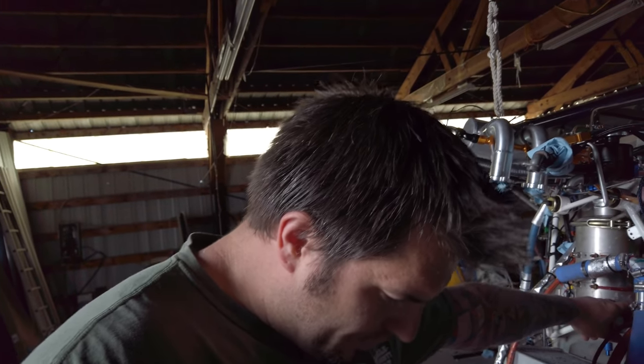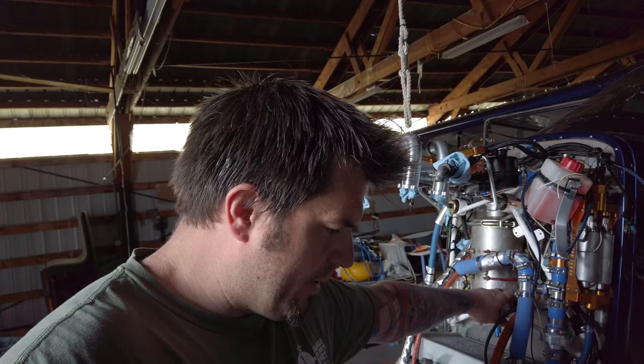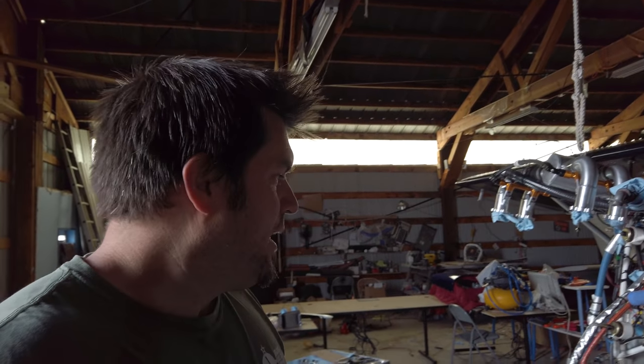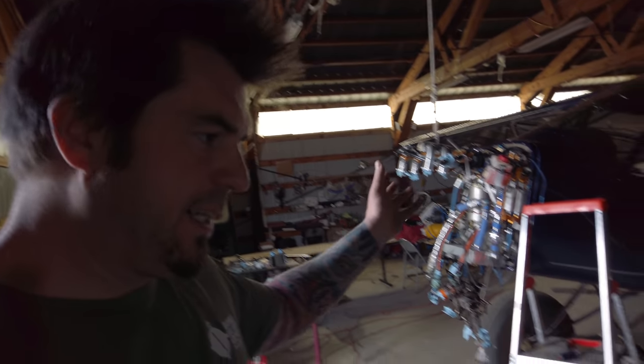So anyway, the turbo in a sense won't have to work quite as hard, but it's still going to make plenty of heat. It's still going to need an intercooler. So I might be able to make more power without an intercooler, theoretically. And hopefully this small intercooler deal that we're working on will be enough. I'm shooting for going to 915 power, getting up around that 140 horse or a little more, since they tend to make a little more than that, at this altitude. Now that's a conservative number, because this engine will be built to take 155, maybe more. But I'd like to stay conservative. I was trying to do that before. Of course, that didn't get me very far. Here we are. But in theory, if I do it like that, this engine will obviously last a long time.